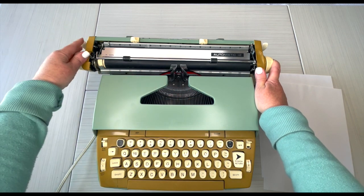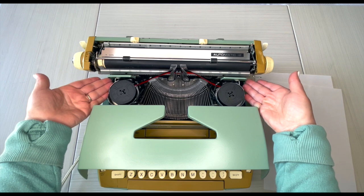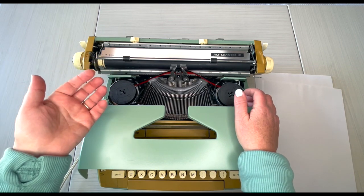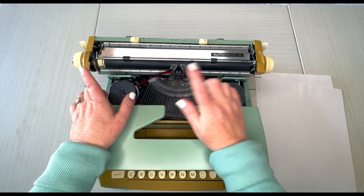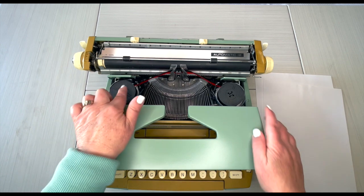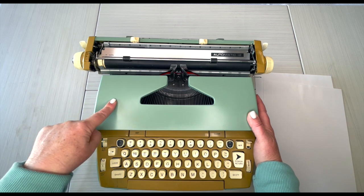To get inside and look at your ribbon, just gently pull this forward — it comes open very easily. You'll see inside a universal ribbon, which is a two-inch spool. If you're not sure if your typewriter takes a universal ribbon, please measure it. If you need ribbons, there's a link in the description below. The end of the ribbon is not the end of the ink — when you reach the end of the spool you still have ink, so you need to reverse the ribbon direction using the ribbon reversal.